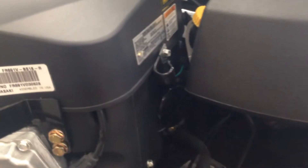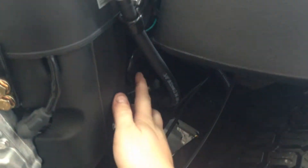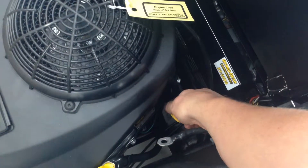Your oil and oil filter — all you got to do is pull this little cap right here out of this, stick this hose into your oil pan, then pull the plug and it'll drain. It's very easy, and your oil filter is right behind it and you can get a good solid grip on that thing. And this here, of course, is your fill point.